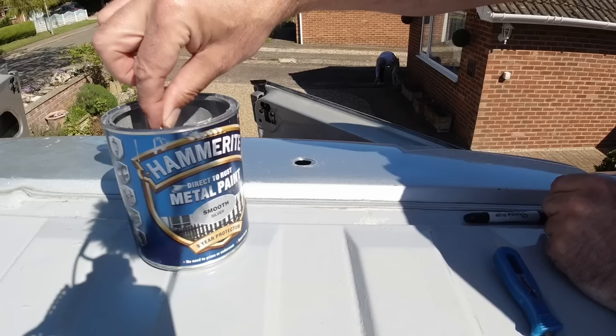You'll notice that I'm going to secure the panels just on the high points of the roof, because that will tend to shed the water, and the water's going to run away in the low valleys where I haven't got any fixings at all. So there's less chance of a leak. Are you there? Yep. Lined up? Yep.